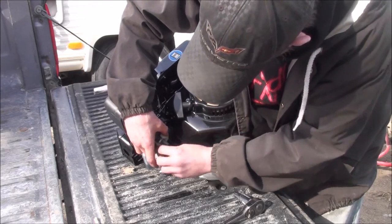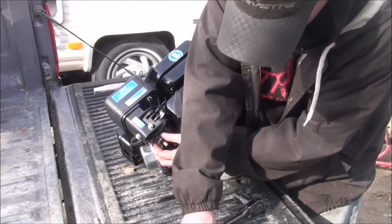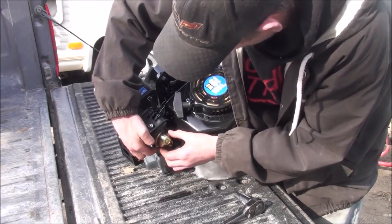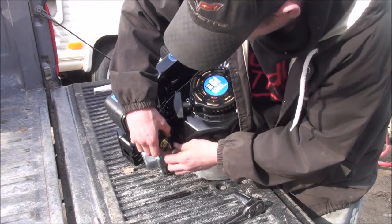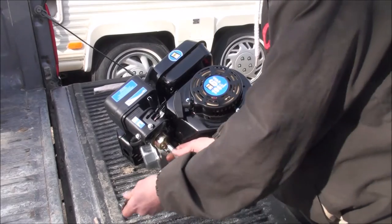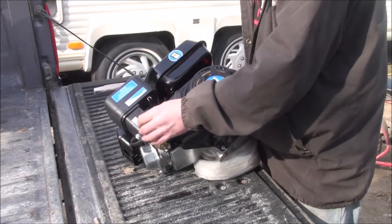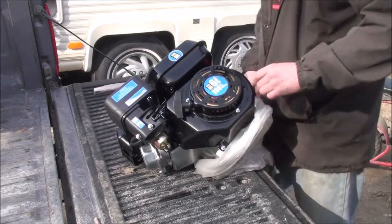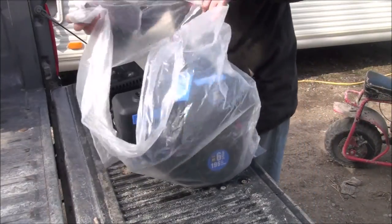Put your rigging back together. It doesn't have to be a new engine — I'm just using this one as an example because it's nice and pretty. I'll guarantee that taking that off so the float has a chance to go all the way to the bottom will make a big difference. You don't need it super snug either, because fuel runs in there and can mess up the gaskets. That one mod will make it perform exactly like a Honda — that's the only difference.